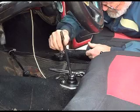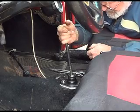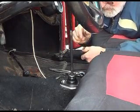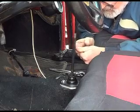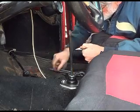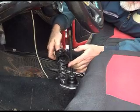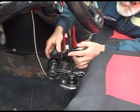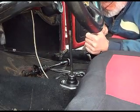Some people don't like it because it's too touchy for them. Reverse would be over to the side and then it pops up out of reverse. You need to keep this piece of aluminum — the factory used a steel dome, and on some of them had a little piece of nylon going over that, because people wouldn't lubricate it and it would keep it freer moving longer. So let's put a shift knob on it and take it for a spin.